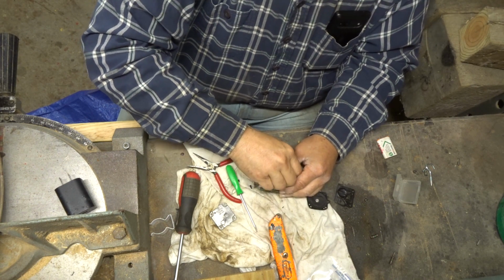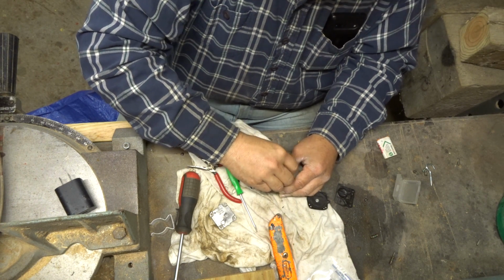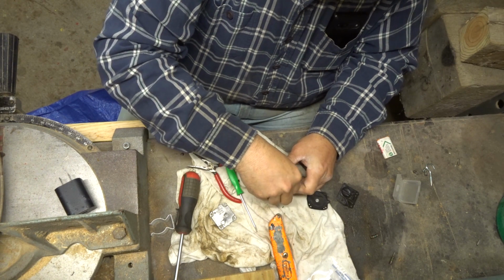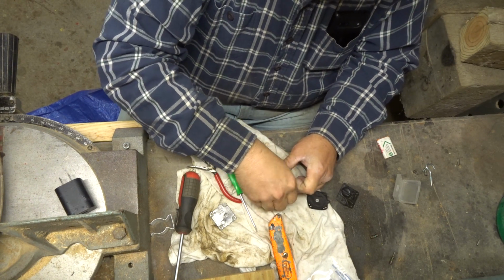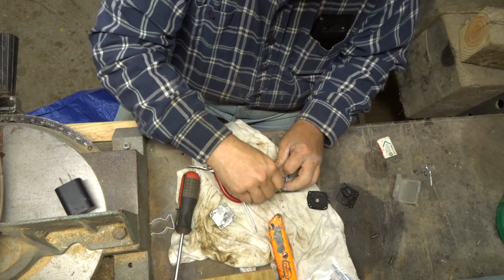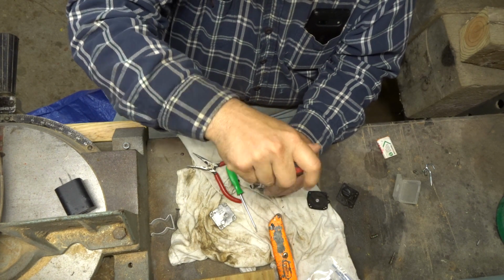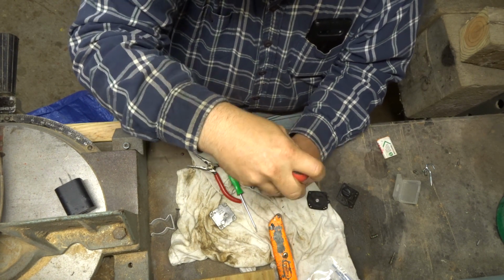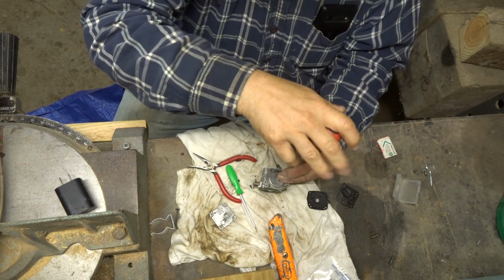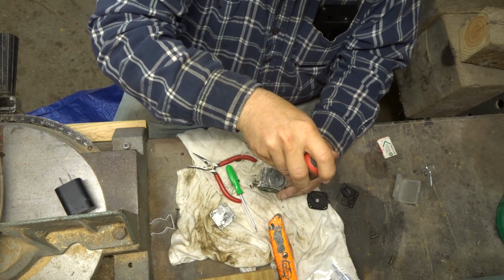Notice I went with carbon choke cleaner instead of brake clean. Learned my lesson working down here. There's not a lot of ventilation, and I think it's because all the air soaks down, like cold air sinks or whatever. So I don't think the air really rises up down here. It causes your lungs to kind of burn, that chlorinated stuff. I'll get hacking and coughing. This stuff stinks, but it's nowhere near as bad.